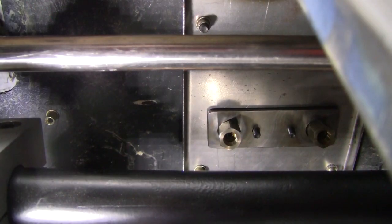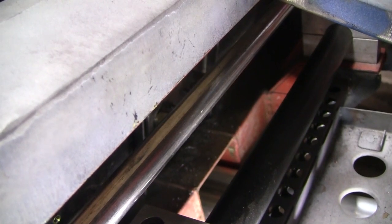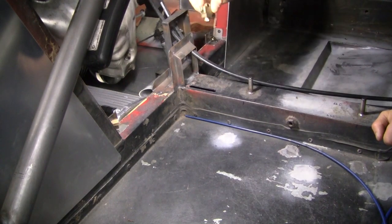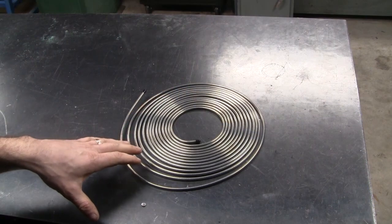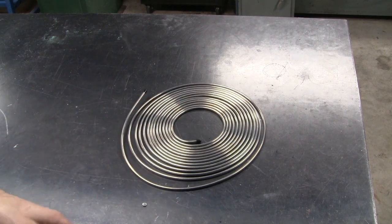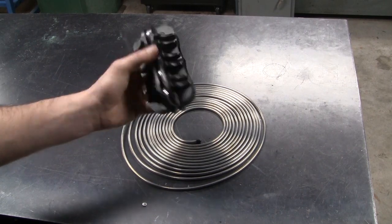With all those brackets in and looking quite excellent, we can start running some brake line. We'll start with the trickiest, which is the rear. We need to come out of that bulkhead, do a U-turn, and come back down the center tunnel, then back out through this oval hole which I cut out with my oval hole saw, into a T-piece which we'll position somewhere about there. We need a straight length of around 1,800 millimeters out of our coiled up brake line. To help straighten it, I bought myself a little tube straightener — this should result in a straight tube and some questionable hand movements.